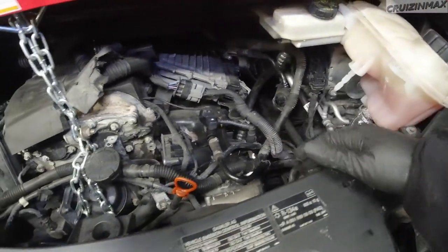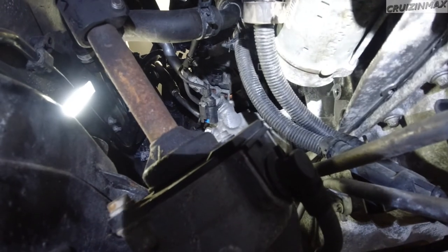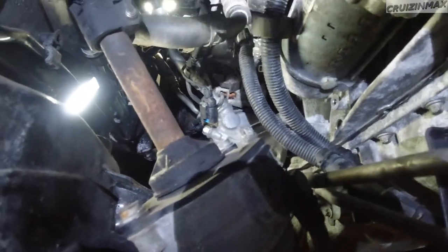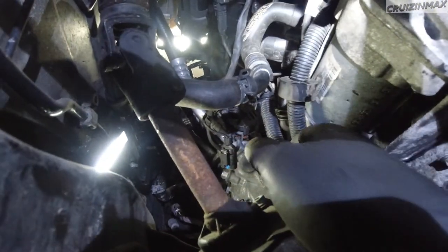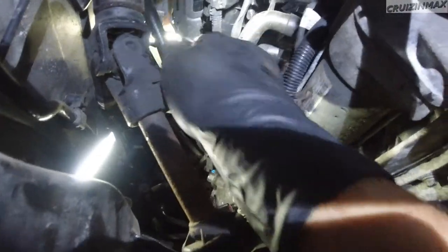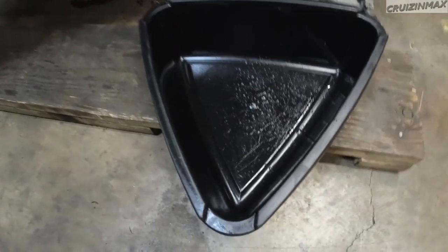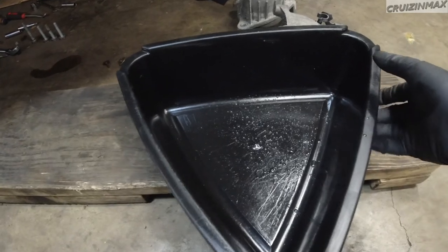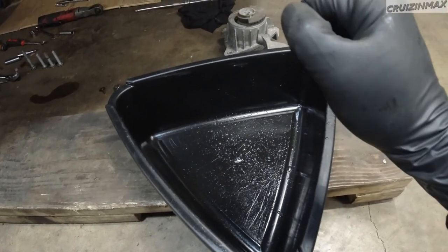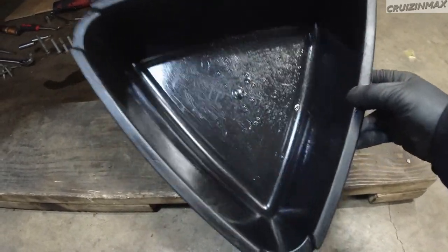There was a plug just behind the AC compressor - you can see one's unplugged and it's hanging down. Unplug that, but it's still difficult. You've still got to go around this harness and keep it up. Taking the actual separator out of the block did take a little persuading. I took a long screwdriver and kind of pulled on the bottom bolt, and it came out.